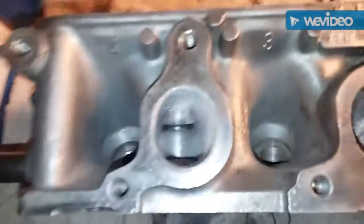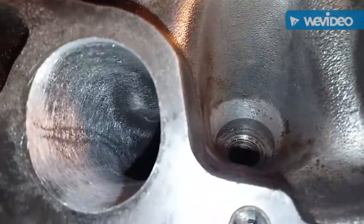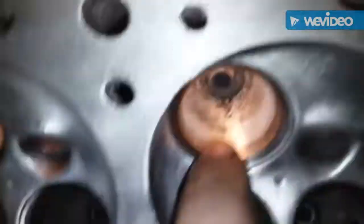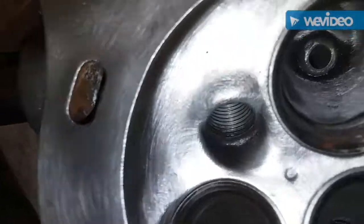It's working pretty decent. The ports have these casting marks that run down the side and I've been trying to remove those — see how it runs all the way down. I've probably been doing this for about 45 minutes, working most of my time on this one port and a little here and there on the next ones. Now I'm taking this rough stone and smoothing out all the uneven casting — that line down there — and there's also like a lip in there. I've been smoothing that out, trying to be as careful as possible not to tear up the seats.